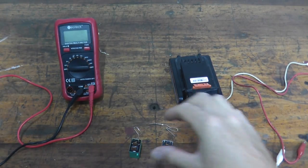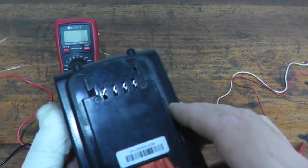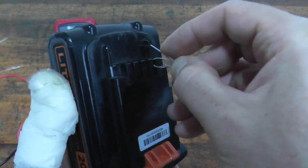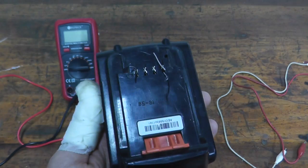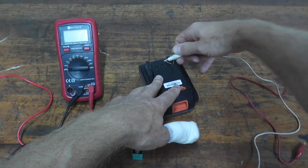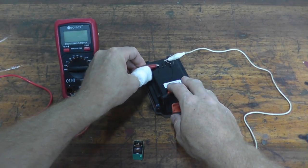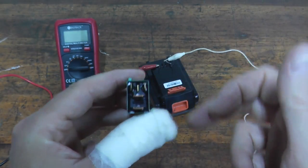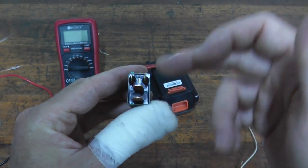Let's start with the simpler four terminal relay. We need to power it up using the negative and positive leads from the battery pack, with the paper clip cut in half. Place one lead into the negative terminal of the pack and the other into the positive terminal. Now, the relay has two series of terminals — a vertical and a horizontal. When testing, you don't want to place one lead on a vertical terminal and another on the horizontal; stay within the same series.